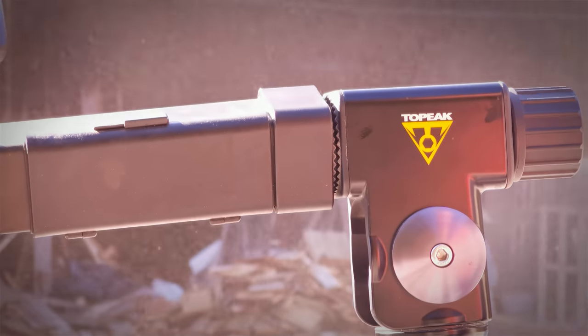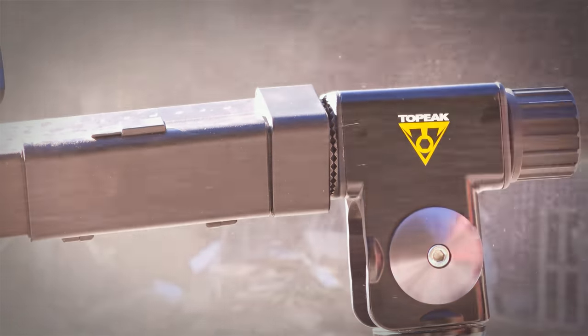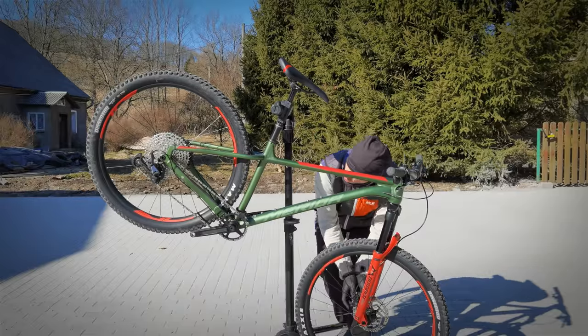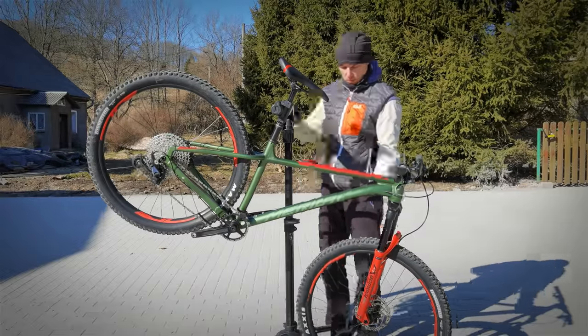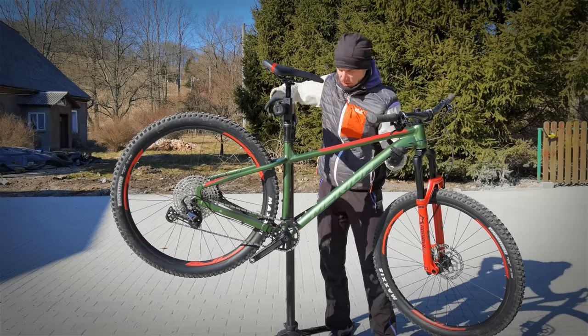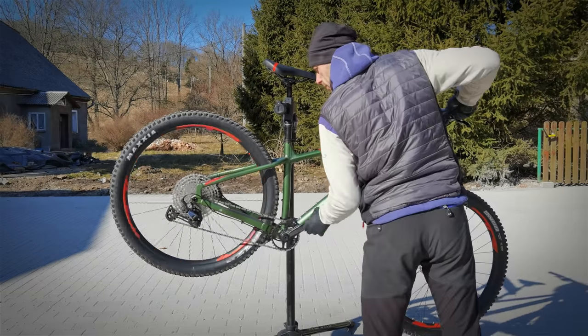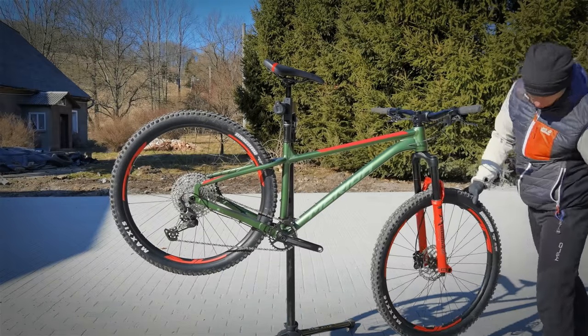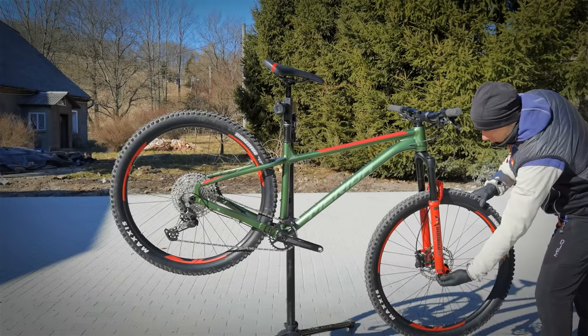This method will minimize the tension on these teeth on your bike stand and also the tension on your dropper post. This is a little too low, my back wouldn't feel comfortable working on the front wheel, so raising the bike just a little, not to the horizontal position, won't put too much tension on the dropper post, my bike stand, and I can work on the rear and on the front of the bike comfortably.